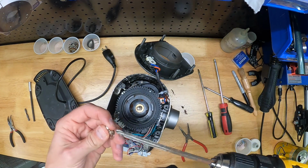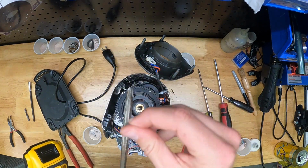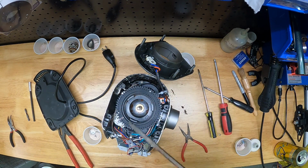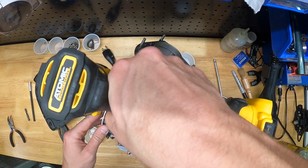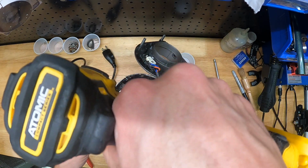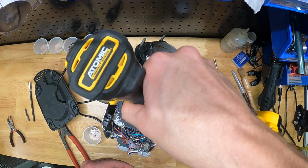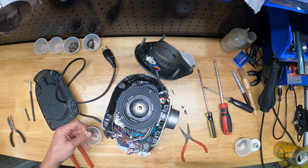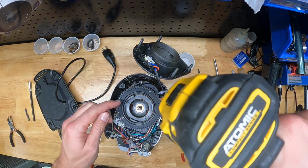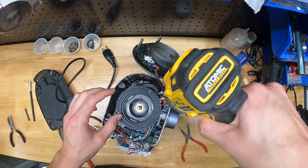With regards to those washers I was talking about, the washers that go directly under the screw have a smaller inside diameter. When we pull this assembly out of the chassis of the grinder, here you'll see I'm rubbing the magnet onto the Phillips head extension to magnetize it so that it'll pull the screw out with it when I back it up. Alright, so like I was saying, third time's a charm. The washers underneath this gearbox assembly have a larger inside diameter than the washers we're removing in this step, so just keep note of that. The 4 pads that hold this gearbox assembly into the grinder chassis are held by 4 screws. Immediately under the screws are the washers with a small ID, and then when you remove the gearbox assembly, there will be washers with a larger ID. So there's a total of 8 washers in this step.